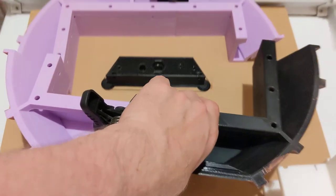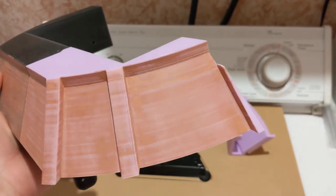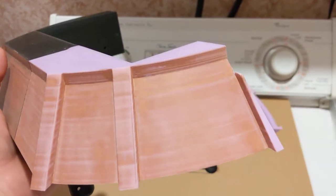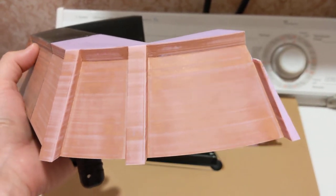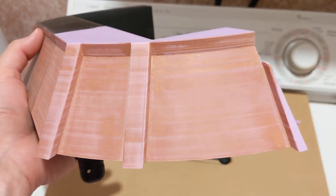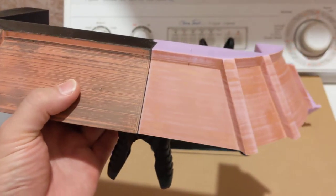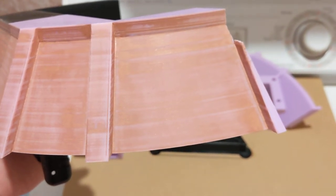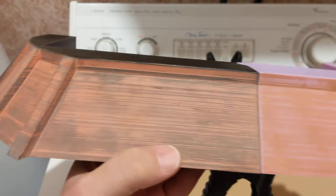So the other thing I'm doing is Bondo glazing putty before I prime. So I use a plastic, whatever you want to call it. It's like a Bondo spreader, or like a vinyl squeegee-type flexible plastic tool, something you use when you apply vinyl stickers to something. So I put some glazing putty on, and then I use that tool to basically force it into the cracks. So it's just a very light coat.